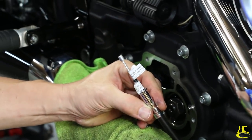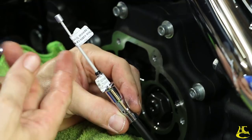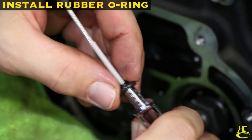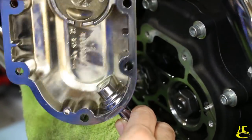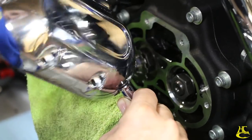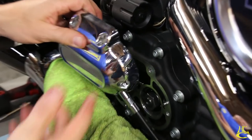The labels say these threads should not be torqued any tighter than 3 foot-pounds, and these are Teflon-coated on the inside and should be lubed prior to installation. Be careful not to cross-thread — it should turn on just hand-tight until you get to the O-ring, then just snug it. Don't use a hammer or monkey wrench on it, just make it snug.